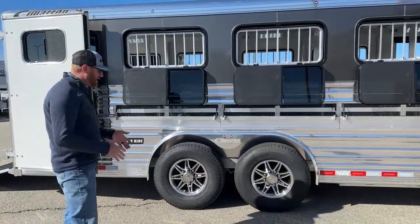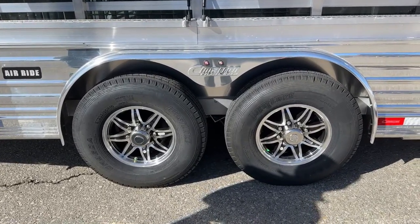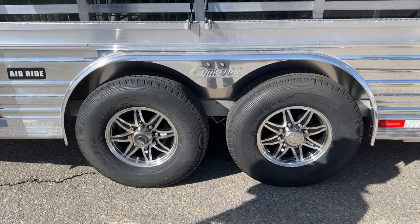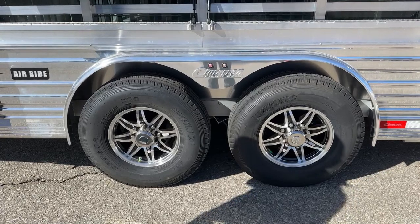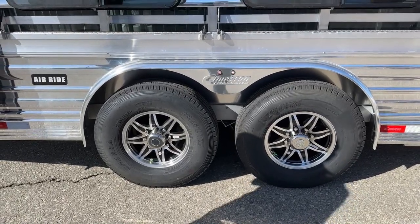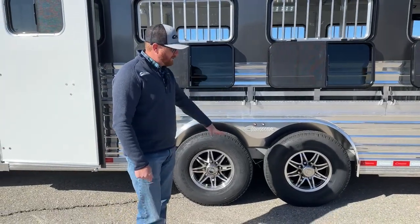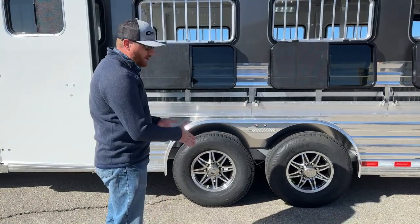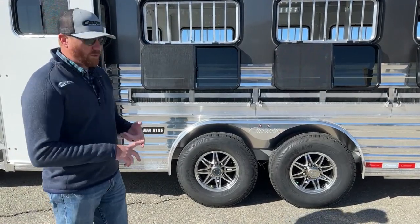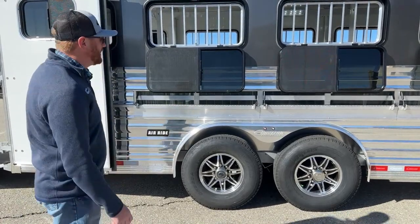Two 7,000-pound air ride axles. We have 16-inch aluminum wheels — black with silver — and we upgraded to G-rated tires on this one. So instead of a 10-ply we went with a G-rated 14-ply, a little heavier-duty tire. They're nitrogen-filled, so we don't have big fluctuations in PSI compared to air. There is a misconception that you can't put air to nitrogen-filled tires — if you get in a situation where you have a low tire, you can put air to it. One-year no-questions-asked warranty from Lion's Head, which Cimarron uses for their wheels and tires. Road debris, blowout, catch a nail, can't be patched — anything like that, you're covered for one year.